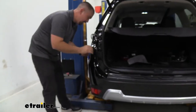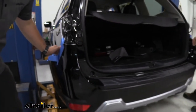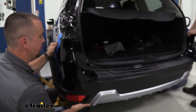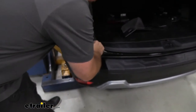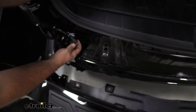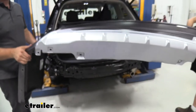Make sure you're not pulling too hard and walking away with the bumper — you don't want to damage the wiring harness. As you work towards the middle, you'll find a wiring clip on the driver's side. Push the tab to separate it, and then you can set the rear fascia somewhere safe.